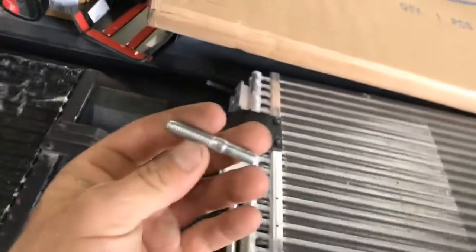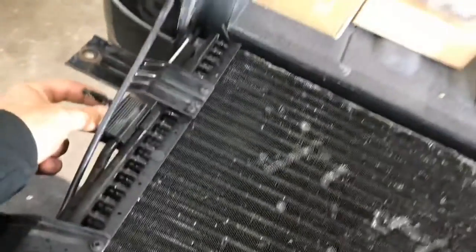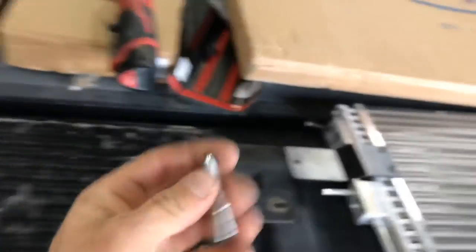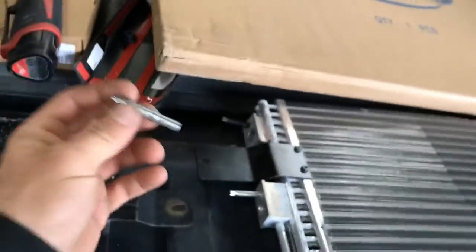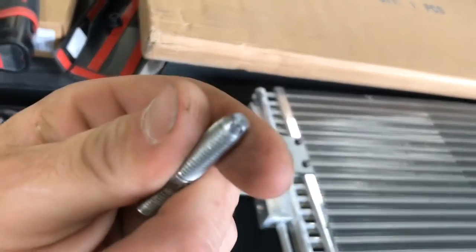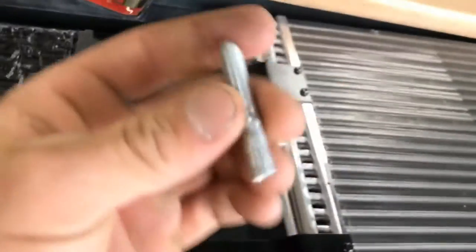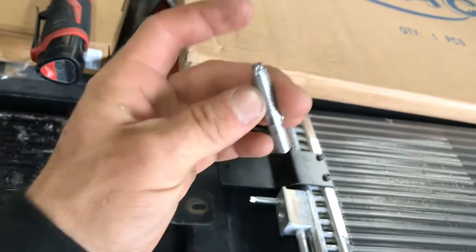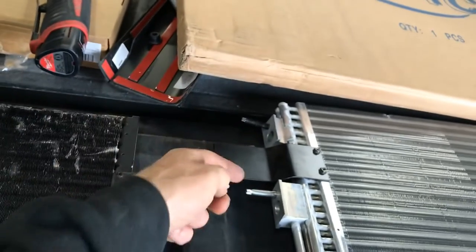This new AC condenser, it does come with some new studs here for where your AC hose mount is up there. You're going to need this stud for it to slide over and then use your existing nuts. Well, I had to grab one of these out of the old condenser. These bad boys are weak. It just barely gave me a little bit of tension, and I went to torque it a little bit, snapped the head off. I had to take my channel locks to get it out. Just watch out for that. If it starts to snag a little bit, these are weak. So go ahead and back it back out.